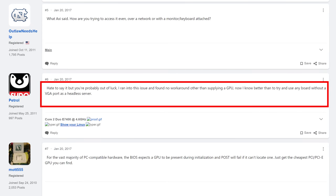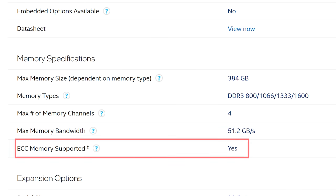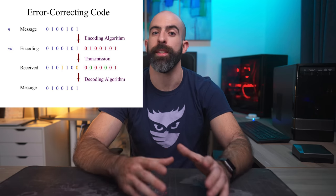For RAM, it's more about what your platform supports and what you plan on running. For a beginner, you can get by with about eight gigabytes, but the more the better. An important thing about RAM is to make sure you're getting the correct type for your system. If you go with a server model CPU like Xeon or EPYC, you'll be able to use ECC, or error correction code RAM, versus regular consumer RAM. ECC is a huge benefit for systems running 24/7, as the RAM is constantly being written to and read from. ECC RAM can often mitigate errors and continue to work, whereas a regular system would blue screen or crash.